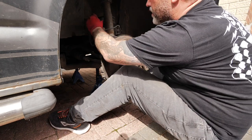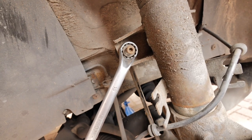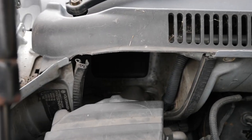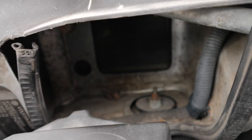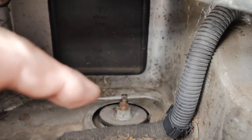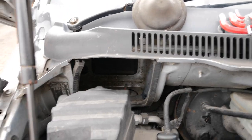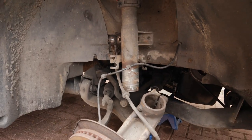Before taking the strut off completely, I need to remove this bottom component — that's a 19mm nut with a 5mm Allen key to hold it steady. Right, everything's off the bottom now. At the top I've taken the little cover off and you can see the cap inside — reach in, take that cap off, and there's the top of the leg. You need two spanners: one to hold the top and one to undo the nut to let it out. It's a bit fiddly so hard to video — I'll get in there and take that off.